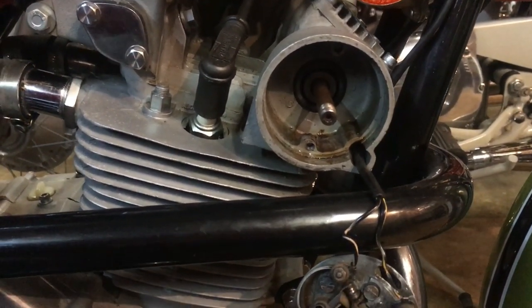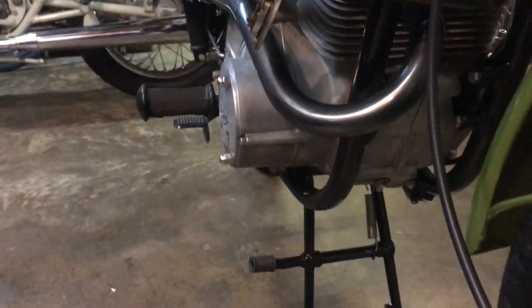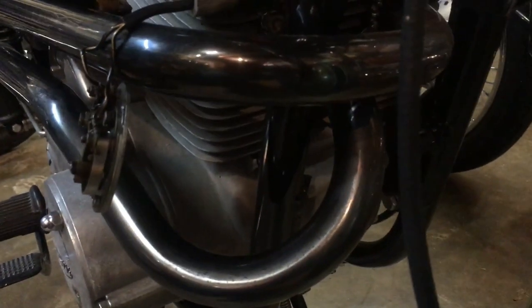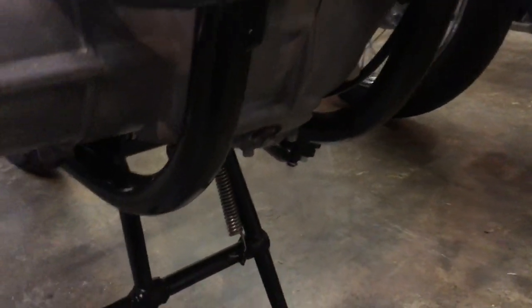Right, so first let's build the auto advance unit up, and then what we'll do is we'll take the two spark plugs out, and I'm pretty sure there's a timing plug, so you can insert something in the crank, and I believe it's in a different position on this, it's there. Whereas on the pre-production ones, it was up here, almost like a special flange. Actually, let's have a look here. Here we are. So this is the SS with later cases, and there it is on the SS. So actually, it is in roughly the same position, but on the other side of the motor.